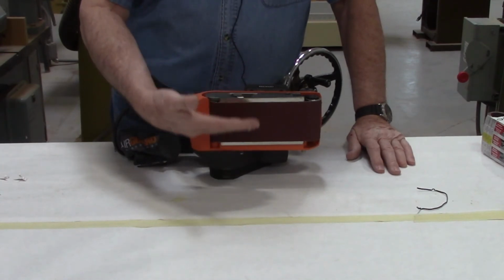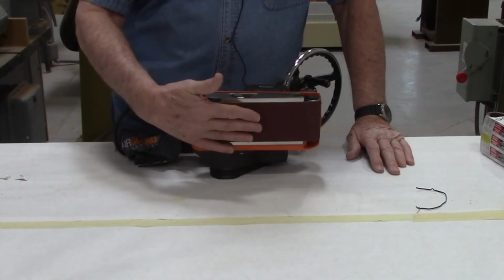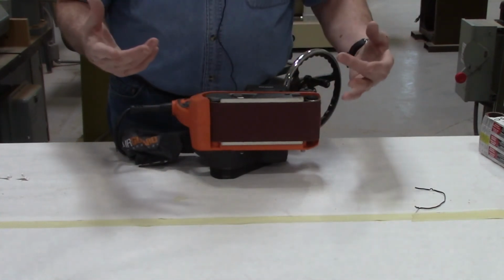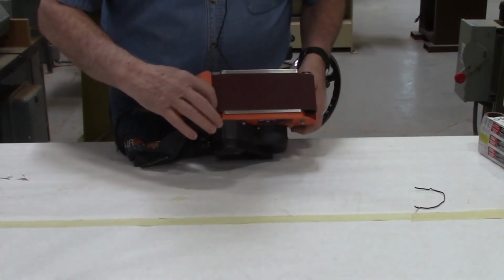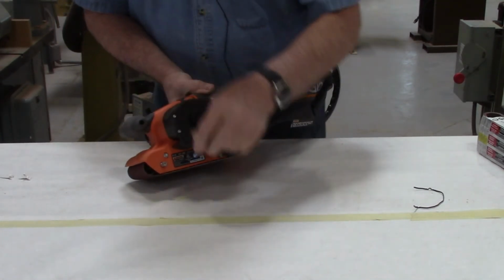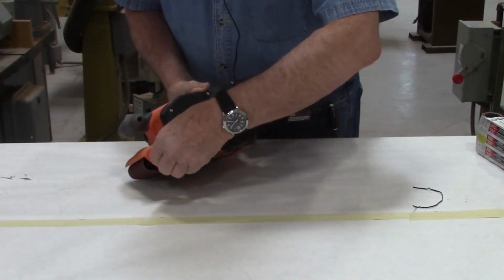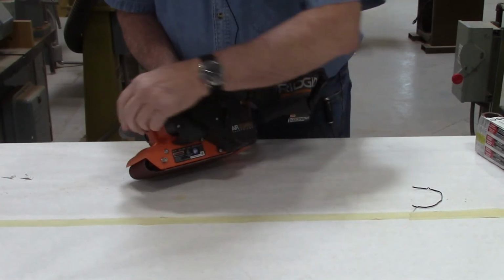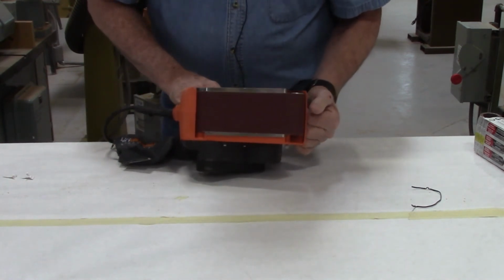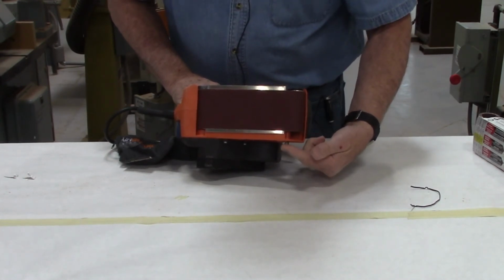The belt will travel. It's called tracking. It will move in one direction or the other. If it moves in this direction, it will eventually walk completely off the rollers. If it goes the other way, it will start digging into the plastic on the side. Now, on this side, there's what they call the tracking adjustment. And this knob turns right or left. And you would simply turn the machine on a little bit and watch it. And if it moves one way, you would simply counter that movement with the tracking adjustment